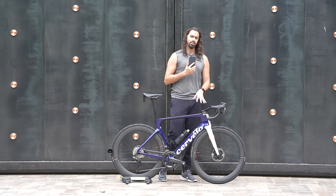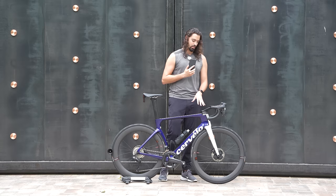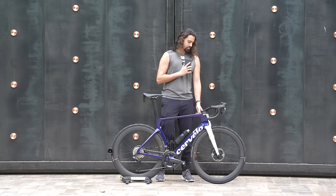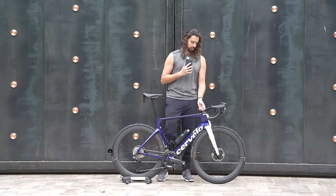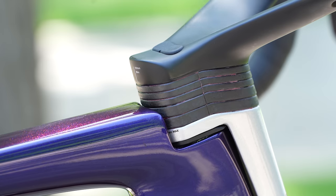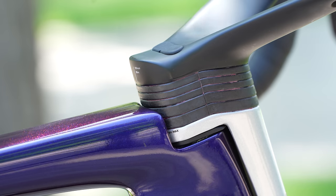This stem is a lot less complex than the previous version. It's held onto the rest of the bike with just three identical screws at the top — take the caps off, remove three screws, and you can remove the stem. Much easier than the previous version where you had to Frankenstein your way through a bunch of cabling. You can fit up to 30 millimeters of spacers underneath the stem, which is the most you can fit, and most people would want to use those because this is a very aggressive bike.